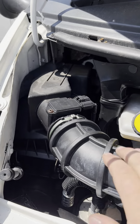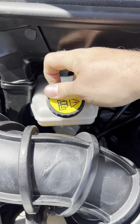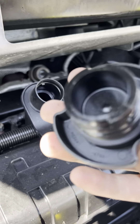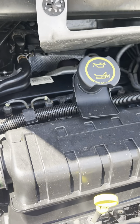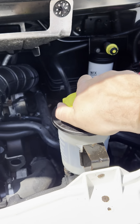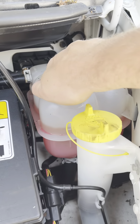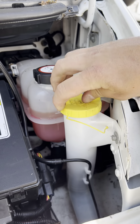On the left hand side we've got the air filter box just inside there. Brake and clutch fluid just here in this reservoir attached to the servo behind it. The engine oil filling point is this point just here at the top — you can probably see engine oil has been changed and is nice and clean. Engine oil dipstick, power steering fluid in this reservoir just here, diesel fuel filter sits just there at the back, engine coolant in this reservoir here at the top right, and your washer fluid in this one just here.